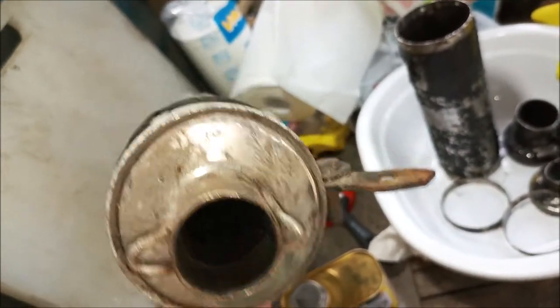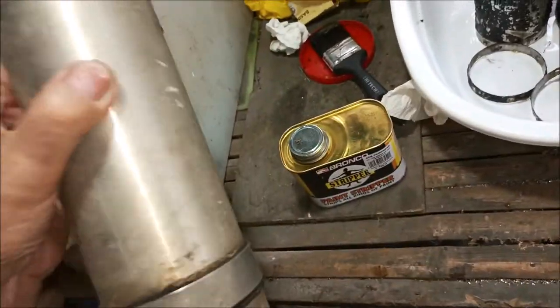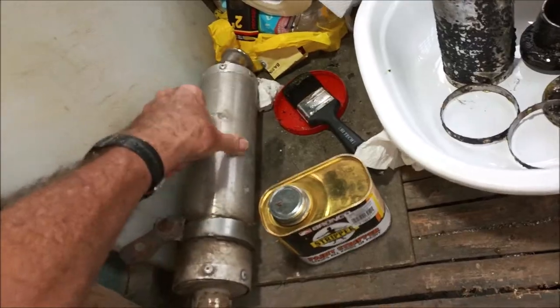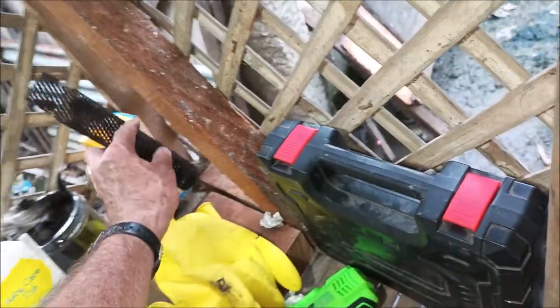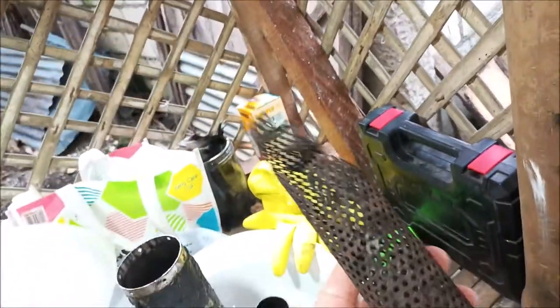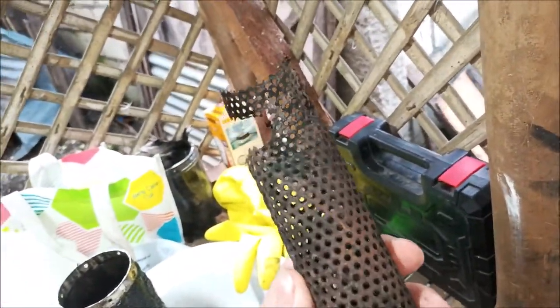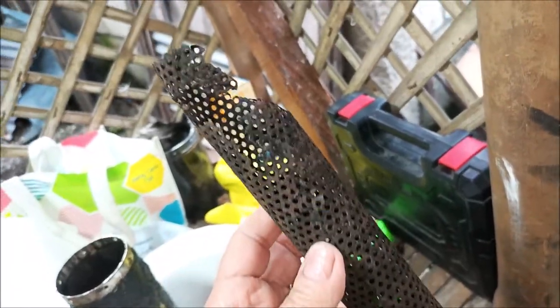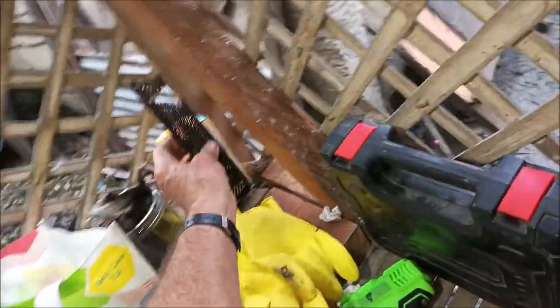But again, I'm going to put steel wool because I think that's a better muffling material. Hopefully the center piece is good. This is the old one here out of this one, but as you can see, it was already falling apart. And fiberglass can come out once it gets like that. So anyway, I replace it with the stainless steel.